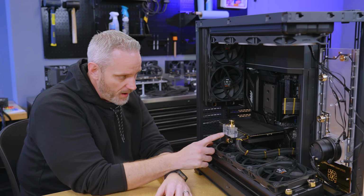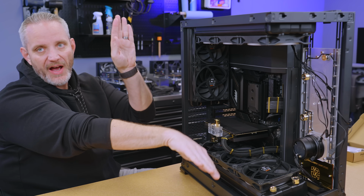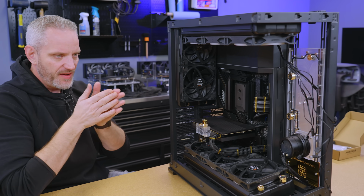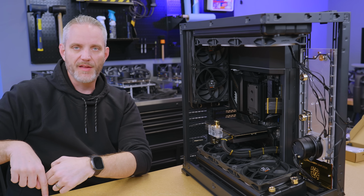And it will flow, believe it or not, through and fill up the first block, but as soon as it hits resistance there, then the flow will divide amongst the other channels. So if I were to have this be a completely clear system and start filling up a parallel loop, you would see the fluid kind of bypass the first opening, and then as soon as it's full, you would see it make that turn, and then they would all meet on the outlet together.